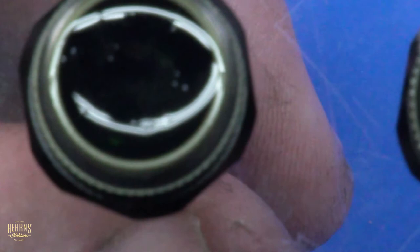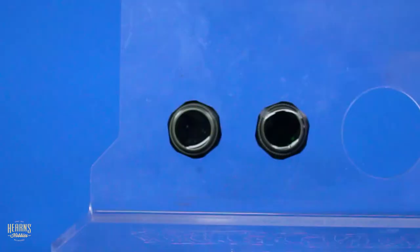See if we can show, but it's pretty hard to see, but you can see those funny little dots. That's air bubbles coming up. Yep. And because of the viscosity of the oil, that can take anywhere between 5 and 10 minutes, really. I like to just shove it out, just bleed it out, mate. Yeah, let's mix some wheel bearing grease in there. That'll fix it up.